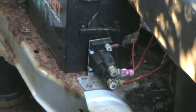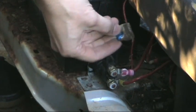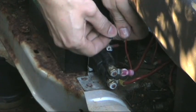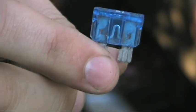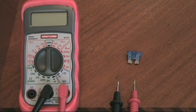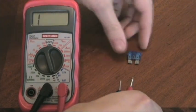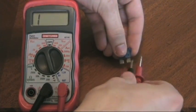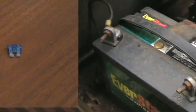If your switches are okay, the next thing you should check is the fuse. This one has a fuse kind of like a car — it's a 15-amp fuse. You can look right in the center of it and see if it's blown. This one is fine, but sometimes a blown fuse isn't so obvious, so if you have a multimeter you might want to put it on the ohm setting and check the fuse just to make sure. This one is good.